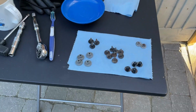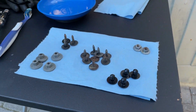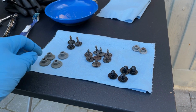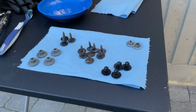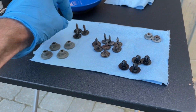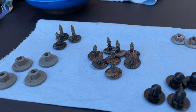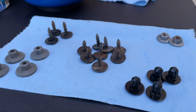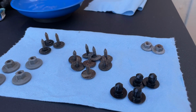Here are the fastenings, just in case you take them all off and can't remember what they all do. Is that focusing? More or less. The plastic ones go on the metal studs in the wheel arches. The longer T25 Torx, they have a little shank on them, go underneath the sill. The shorter T20s go variously in the wheel arch and other places.